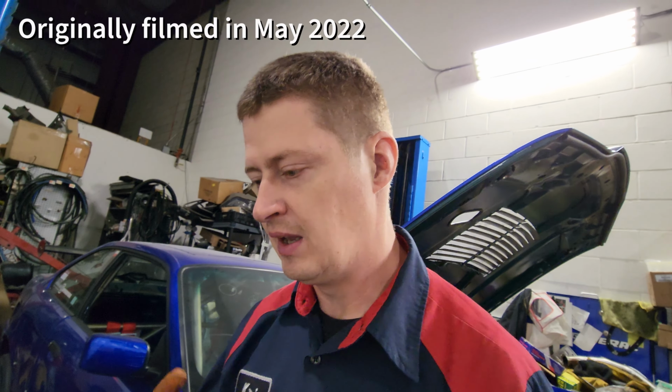So the best way to fix this is to take the wastegate apart, either replace the spring inside and retest it again, and obviously clean everything possibly. I do have a knockoff spare here, which is pretty much the same deal. The connection for the V-band is absolutely different, so I am stuck with this particular wastegate for the time being, because I would have to cut that out of the exhaust manifold. So let's just stick with this and use the springs that I have extra from that.